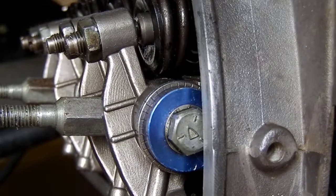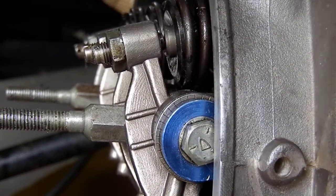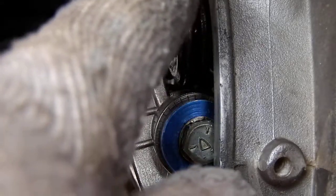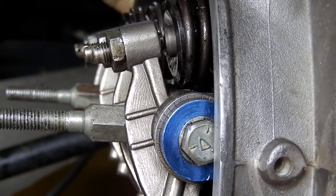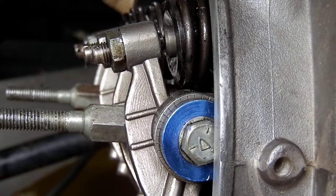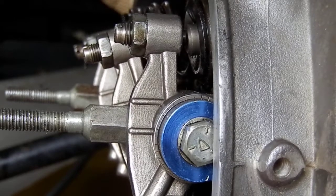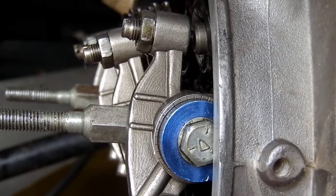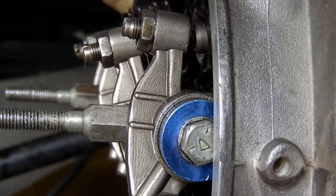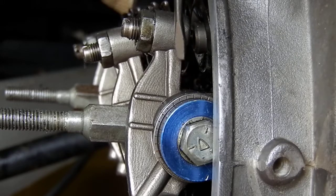I'm going to move the camera over just a little bit and as I cycle this through, at max lift this rocker arm should sit parallel to the edge of the head itself. We don't want it traveling too far and being off angle. Cycling through to max lift — on my timing mark I'm right at 90 degrees on this particular stroke — we want to make sure that this part of the rocker arm sits as close to parallel to the head as possible.